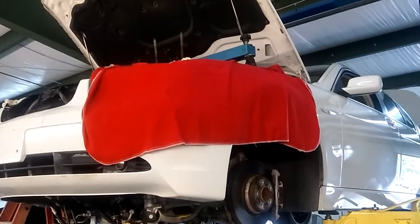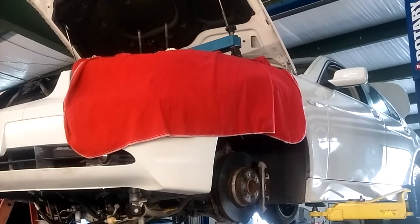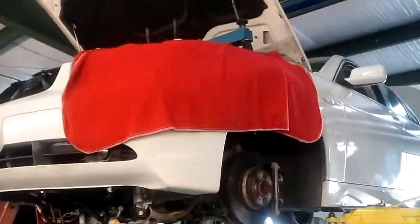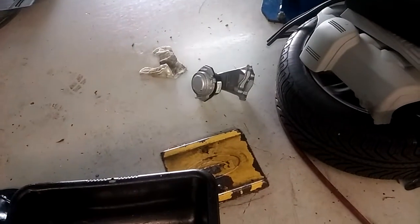Support the engine on the top. I did it once on my 745i a couple years ago in the garage — it's doable but this is much easier. You support the engine, drop the whole front suspension, let it hang, support it right here, and you have nice access to the motor mount, and of course there is the leak.